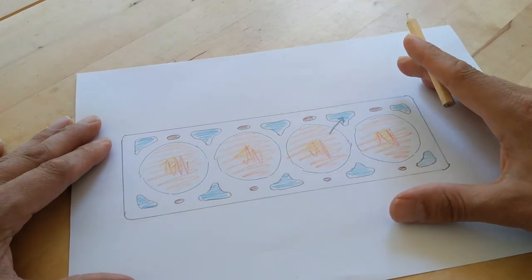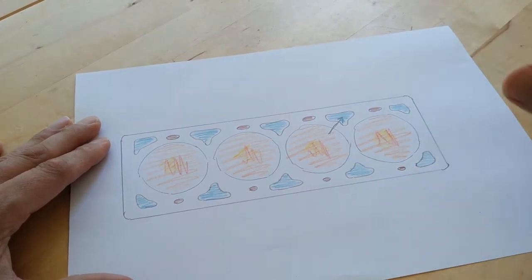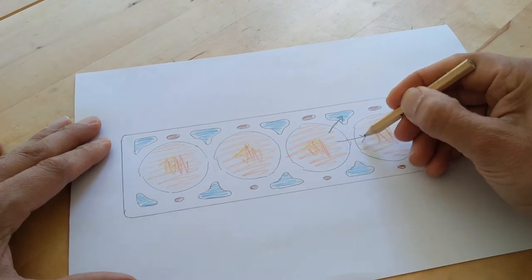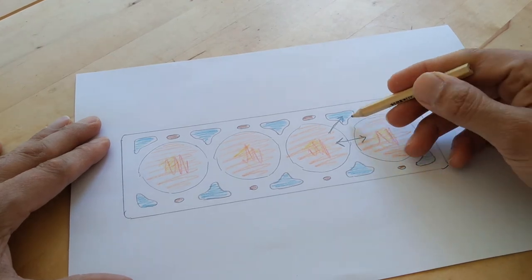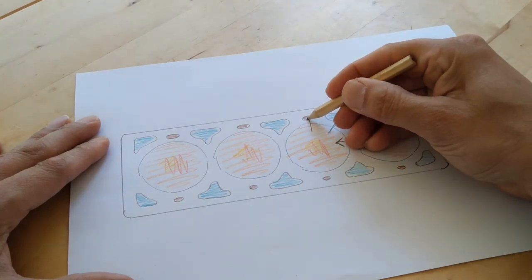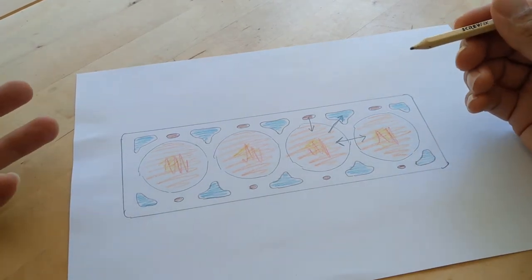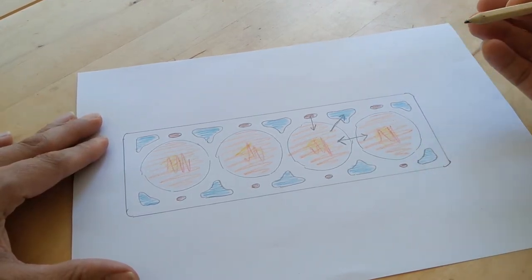But now let's say that test negative for you. Does it mean that your head gasket is fine? No, I don't think it does. I'm sure it doesn't, in fact, because let's say, for example, your head gasket is blown in between cylinders like that. So that's still a blown head gasket, but that's not going to cause CO2 to get into your coolant passages. So it's not going to give a positive test. Or let's say your head gasket is blown into one of the oil passages like that. Again, that's a blown head gasket, but it's not getting into the coolant, it's not going to give the CO2 in the coolant for that test to prove positive.